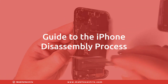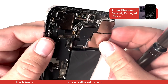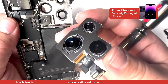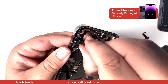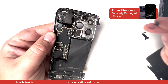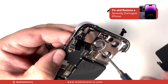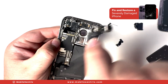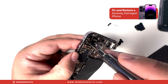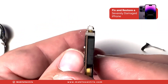Off comes the bracket. Let's take a look at the camera. Pop off the camera bracket and pop out the camera unit — which actually looks like it's in really good shape. Disconnect everything that's connected still to the motherboard. There's the rest of the proximity sensor. Let's remove the loudspeaker so we can pop out the motherboard. It appears to be intact. Front facing camera assembly and then the one little hidden standoff screw here at the top. Out comes the motherboard and looking down it, it looks pretty straight.